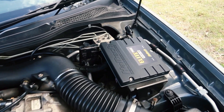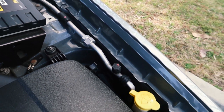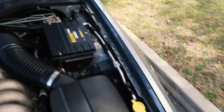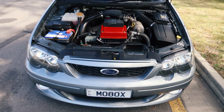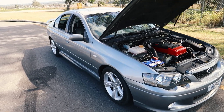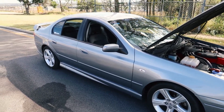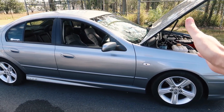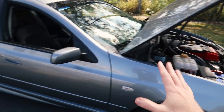This is an XR6 Turbo, of course. I like to look around under the seams here of the front guards and make sure there's no rusty marks coming out from anywhere. If it looks pretty clean, that's a good sign. The condition of the paint in general is going to tell you — has the car been garaged for the majority of its life? If it's totally sunburnt and faded, that's a warning sign it's been out in the weather. Just like the AU, these cars do not like being left out in the weather because they are very susceptible to rust.